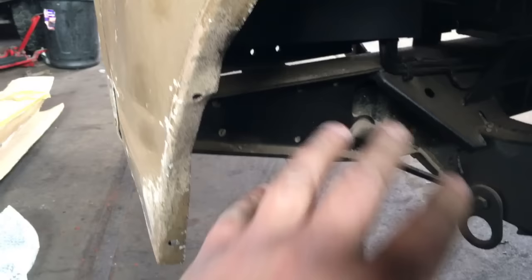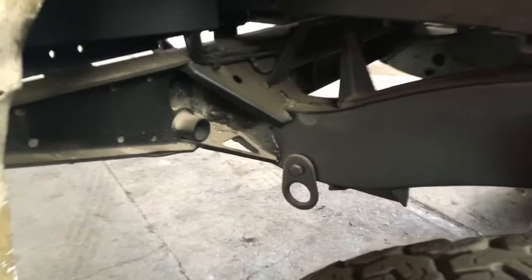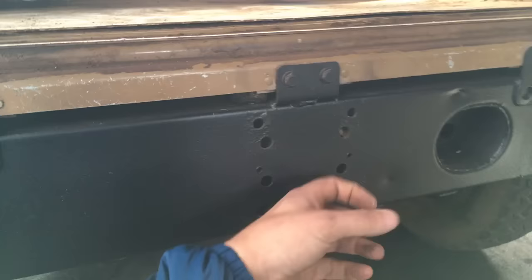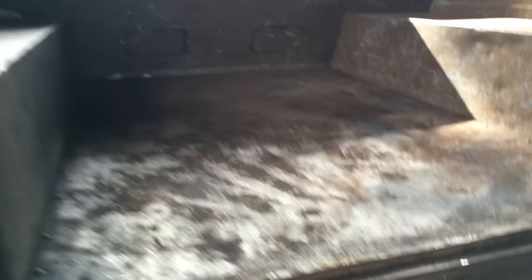Working to the back, check the rear crossmember from the inside and out. Check the corrosion on the inside of the spring hanger mounts where mud tracks — ask permission to remove any mud with a screwdriver to check the integrity of the chassis. Moving to the very back, always check the rear crossmember for botched repairs or cover-ups, and make sure it's solid if you're going to be towing. Finally, do a quick check for any severe knocks — these vehicles are boxy so check the lines are good and everything is sound, and then you should be good to go. This is Fraser from Rugged Guide signing off — I hope you enjoyed the top tips for your Defender buying guide. If you enjoyed what you saw, please subscribe and like, and we'll see you again soon.